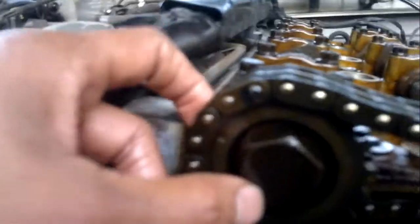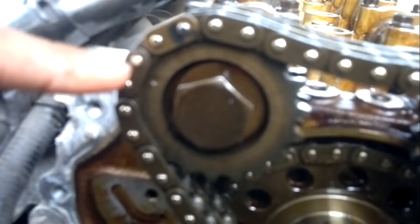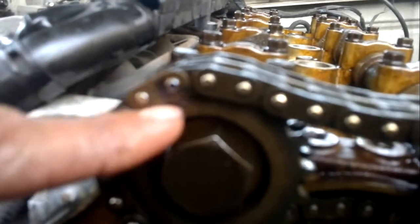On the other hand, since you're using an exhaust camshaft on the intake side, it'll be around here. If you were going four teeth counterclockwise, which people do for higher-end builds, it'll be around here. So just count the amount of teeth — go counterclockwise.